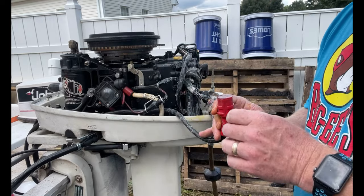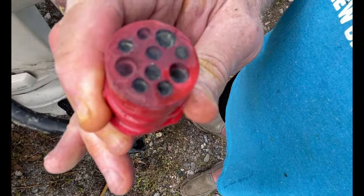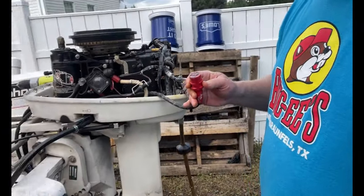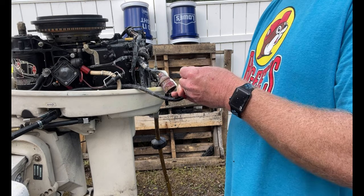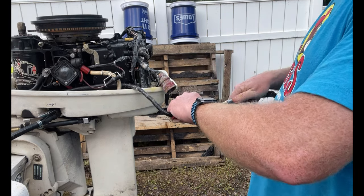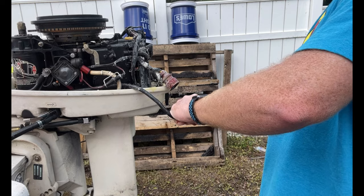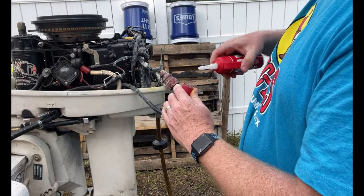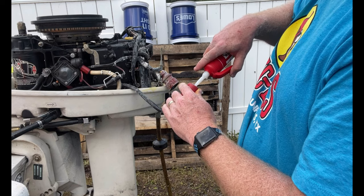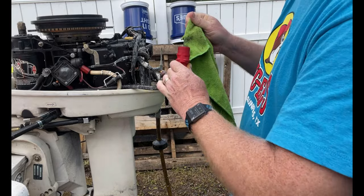In there I don't see any more bubbles coming up out of that at all. You can kind of see down in there — no bubbles coming out, which would indicate the presence of any kind of corrosion. So there is that. One side is pretty clean now, so now what we're going to do is just put a little dab of dielectric grease on each of the holes, making a little waterproof covering for the contacts that are in there.